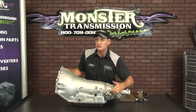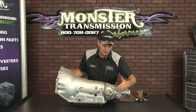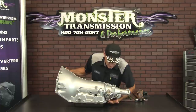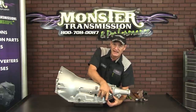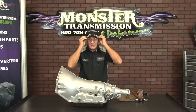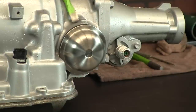The first thing we do is remove this cover. You can remove this with the transmission still in the vehicle. It's a little bit more difficult because the crossmember crosses under here, but if you get a screwdriver and get behind the lip of this cover, you can knock this cover off. It's just hammered onto the casting of the case. Safety first — we'll put our safety glasses on. You do not want to hammer down in, because you can rupture or puncture a hole in the cover.